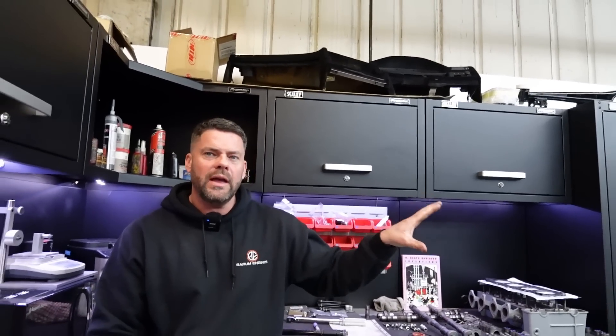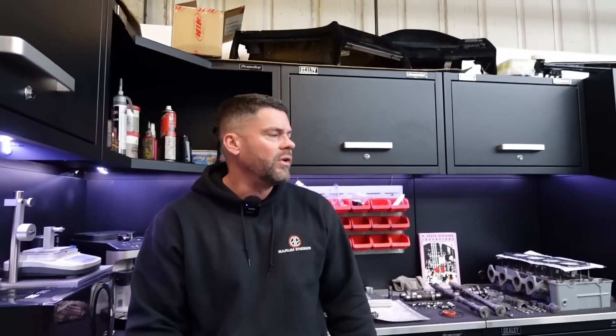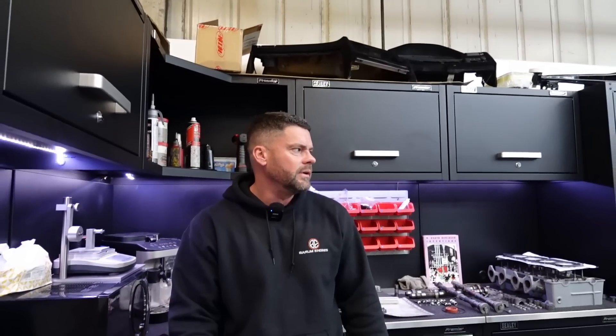A BDG is what we'll be building — that'll be seen later in the year. The main thing is, it's from the BD series, it's an aluminium block, a fairly funky genuine RS1800 Mark II engine with the three-stud exhaust flange on the head, all tricked out — nice bit of kit, just needs a freshen up. The hardest part will be finding some of these bits, although Burton has most of them. The rings at the moment are a little hard to find. Bearings are fine — a lot of it marries up with cross-flow stuff in terms of sizes.